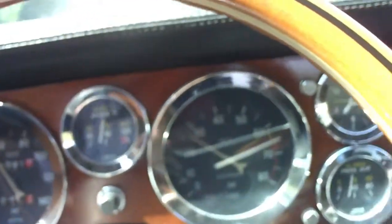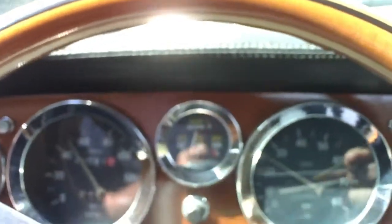We've gone roughly 11 miles uphill and we're just hitting the 180-degree range now. As you can see on the temperature gauge, we're still well below 190. In this car in stock form, the temperature would have been maintained at 195 degrees, so we've made a nice improvement in how cool the car runs even under extreme conditions like this. We've just about reached our turnaround spot — we're entering Mount Baldy Village — and the temperature gauge is still down in the 180 range.